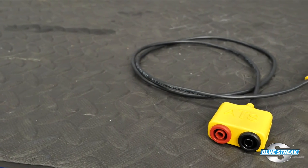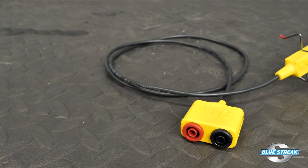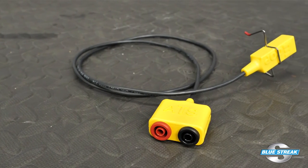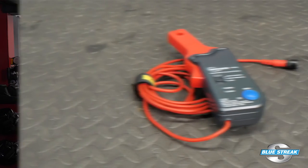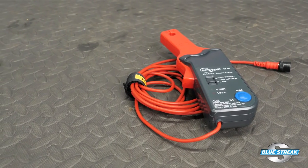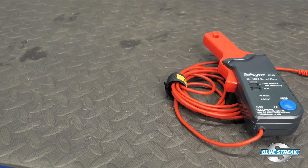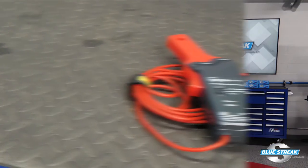One of the best ways to test the condition of the output of the coil is to use a capacitive probe and measure the secondary ignition waveform. If you can't find a known good, compare it to a waveform for another coil on the engine. To test the primary side of the coil, you can use a current probe placed around the positive wire going to the coil. With this test, you can see if power is being sent to the coil, if the engine management system is trying to control the coil, and also look at the current ramp.